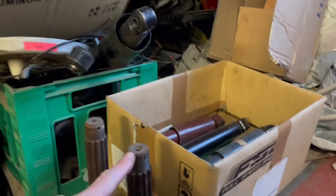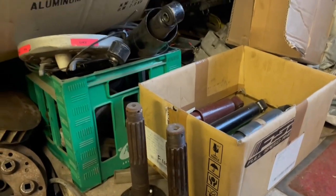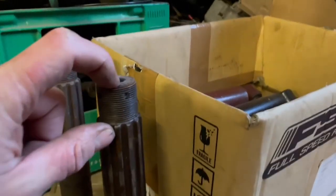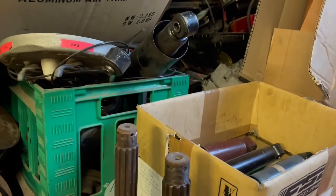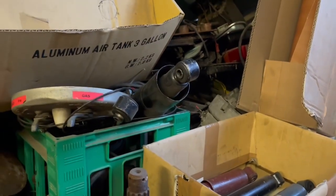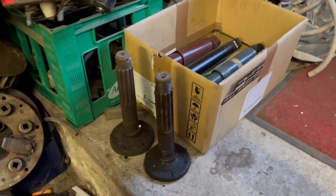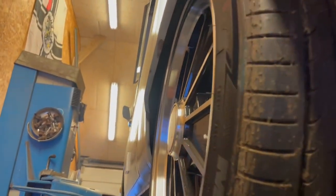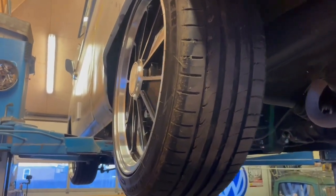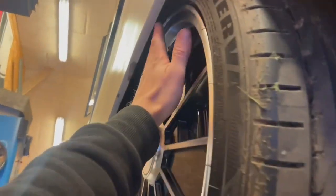If you take a little bit off the drum and make it the right width, you can have center caps on because you don't have the axle sticking out through the wheel. It makes it more convenient and looks cooler — you don't have a bolt sticking out on your rims. An early bay axle doesn't work for this, you have to get a late bay axle. No axle sticking through, it sits nice and there's room — good times.